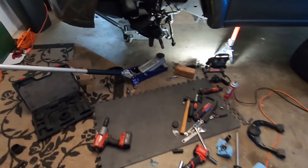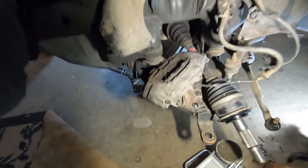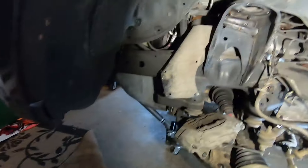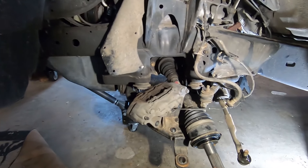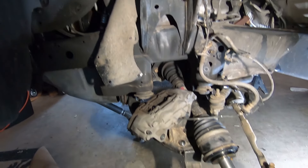We've got the heat going so it's kind of loud — I apologize. This whole side has just been trial and error. Literally everything only took me about 30 minutes except for the ball joint, which is attached to the knuckle. That was such a pain because this tool doesn't fit in the wheel well, so you have to take the entire knuckle off or bend it out, which was pulling on the CV joint and the brake line. So I just took the knuckle off.